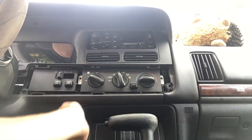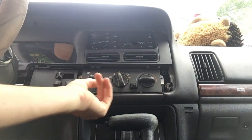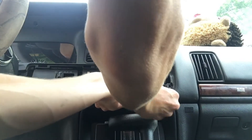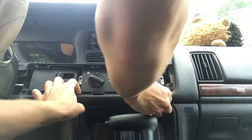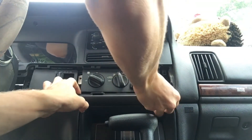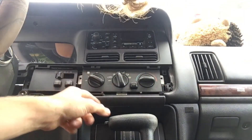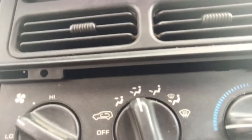Next, you will pull on the bottom plastic that goes from underneath the steering wheel over to a little piece right underneath the climate control. You need two hands for this — and then it just pops right down. Then you remove this screw right there.